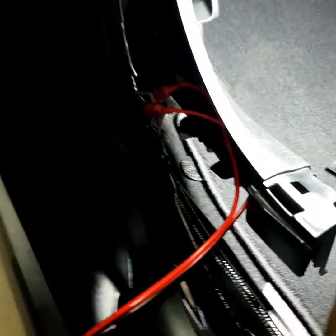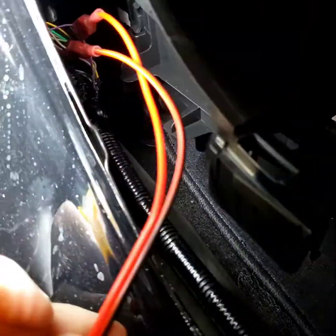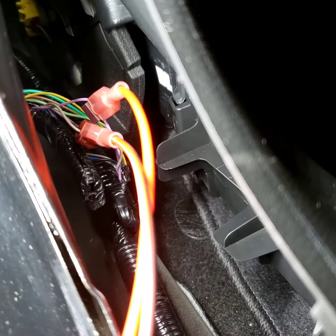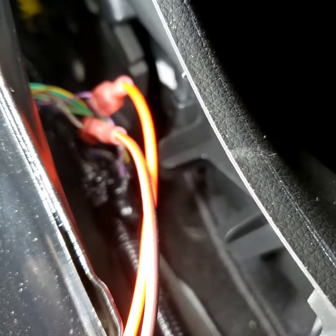As I said earlier, the red one, I got speaker wire. Some speaker wire might not be red and red-black. So I consider red as positive, so I hook it up to the purple. And then the red-black I consider as negative, hook it up to the gray one.